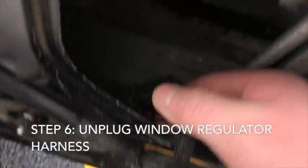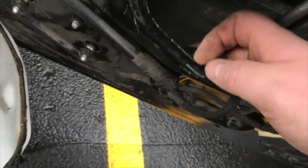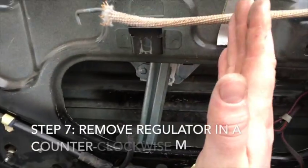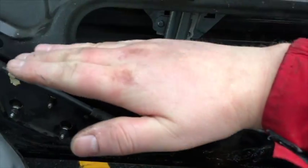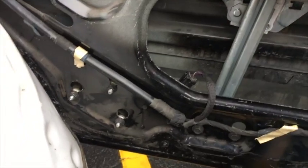And then the plug itself, you pull out the red clip, the safety harness, and then there's a little tab in the back, you just pop it out. And then the easiest way this comes out, once you remember, you have to also unbolt it from the window. Be very careful with the glass, because then the glass is free. And then the way this comes out is work the whole piece this way, just rotate the whole piece until this long beam becomes horizontal, and then as the whole piece rotates, it easily fits out this hole.